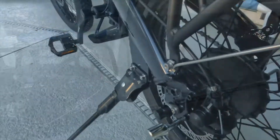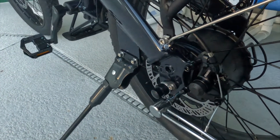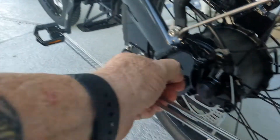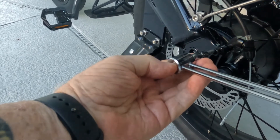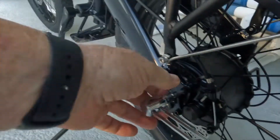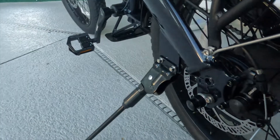Let me check the ones in the back here. Hopefully they didn't change that size. I'm going to tighten that down — it was loose. Now it's up to 7 Newton meters, so I'm okay there. Do the top one. That one was loose too, and that one's been torqued down to 7 Newton meters. What I'm doing now is going through the checklist and I'm not going to bore you with all of this.